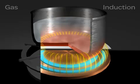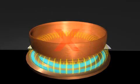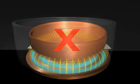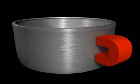The drawback is that only pans made from iron will work with induction stoves. Pans made solely of copper or aluminum conduct electricity too well to generate significant heat. Cast iron, stainless steel, and pans made with layers of stainless steel all work. As a rule of thumb, if a magnet will stick to it, you're good to go.